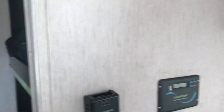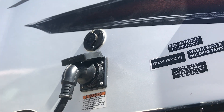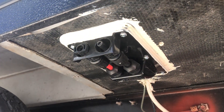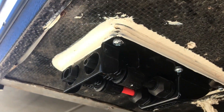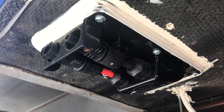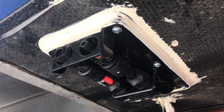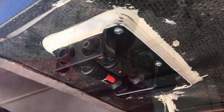There's one more thing I added. I took power from the top of the solar charge controller — not from the battery side, from the solar side — took two extra wires, ran them down below through the back of the junction box, and then routed it back towards the sidewall. Here is that back wall — this is where the power runs in, and the other side of this wall is actually where the power converter box is. What I did was I added an MC4 connector set onto this, and basically took those lines off the solar charge controller and added it straight onto here. I had to drill an extra hole, but I added this particular port onto the side so I can plug solar panels directly onto the side of the actual unit.